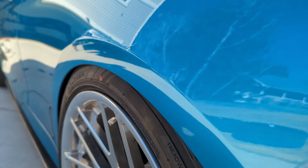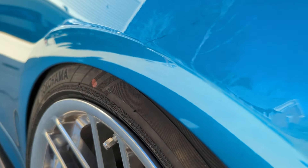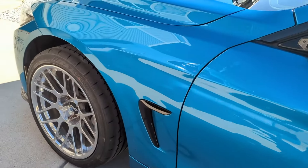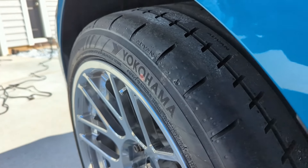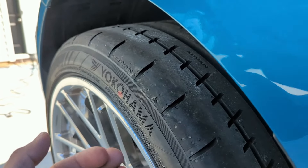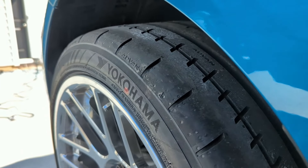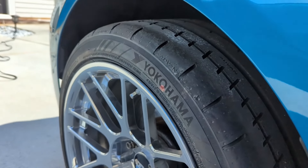It really has to compress quite a bit — I'd say maybe an inch and a half for it to even get to rubbing. But I haven't test-driven it yet, so in this video we won't cover that. For the front, if I want to keep these tires, I'm gonna have to do camber plates, or drop down to maybe a 245 — which would probably clear without any issue. But I like having the same amount of stretch front and rear if possible, so I think I'm gonna have to do camber plates. Plus, I've always been a big fan of having a meaty setup with a little bit of camber up front.